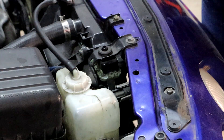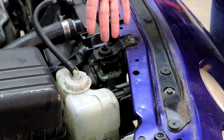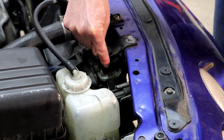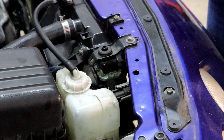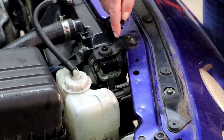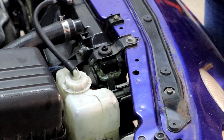You may be wondering why we're replacing the radiator on Blueberry so soon. Well, check this out and wonder no more. This is what happens when it starts weeping through the crimp on the top plastic tank — this is not good. This means the radiator's on the way out. So what we did is found one on Rock Auto for less than a hundred bucks, and we're going to throw her on.